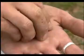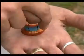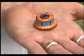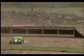And then lately we've got various new developments like the CRF V6 clutch, where we've got 6 little pads that push forwards and out with centrifugal force to grab the clutch. If you can get your clutch set up just right to bite spot on out of corners for maximum control and acceleration, you're in with a shout.